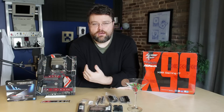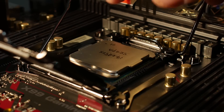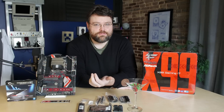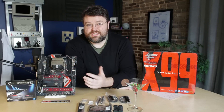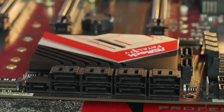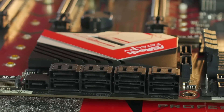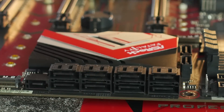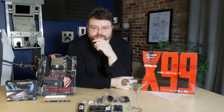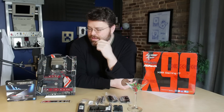If you're going to be running SLI and other PCI Express peripheral add-in cards, you're going to have to get a 6850, which has more PCI Express lanes, rather than the 6800. But if you're only going to run one graphics card, a few peripherals, maybe one peripheral and a single M.2, then you're fine. This does support dual M.2. You've got six SATA 6 ports and one SATA Express port, so you can use a SATA Express peripheral or an external 2.5-inch NVMe rather than an M.2 NVMe. The new two gigabyte per second NVMe is really tempting to use with this board.